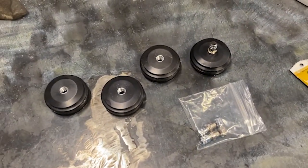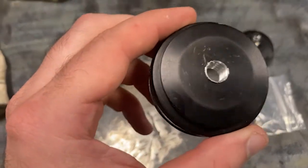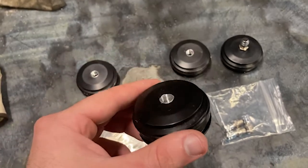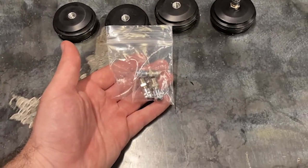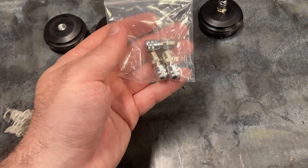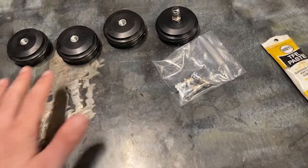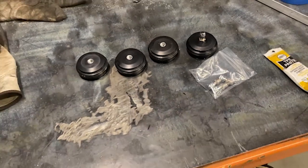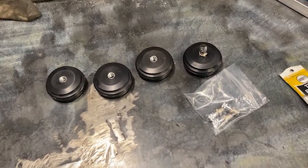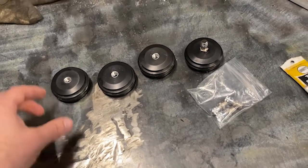This one still has the stock caps, so looking at these stock ones we took off, we thought we could just drill out the existing valve assembly. We drilled out the old stock caps with a 21/64th drill bit, then tapped it with a 1/8-inch NPT, and then bought some 1/8-inch NPT high-temperature, high-pressure Schrader valves — basically $8.50 apiece. Overall you could do this whole replacement on your own machine for about $35, as opposed to buying somebody else's for $65–$70 for a pair.